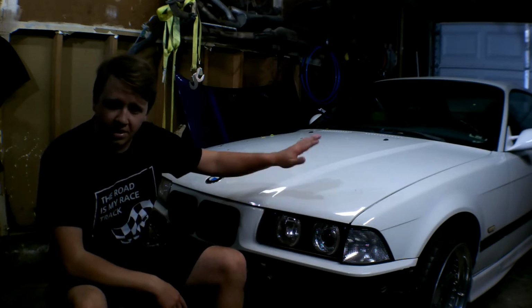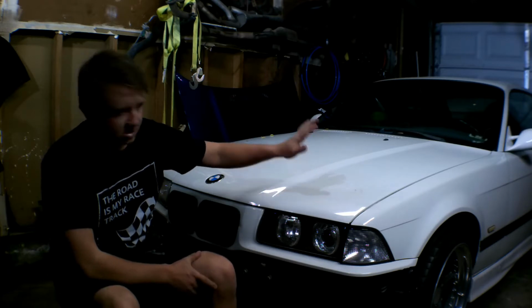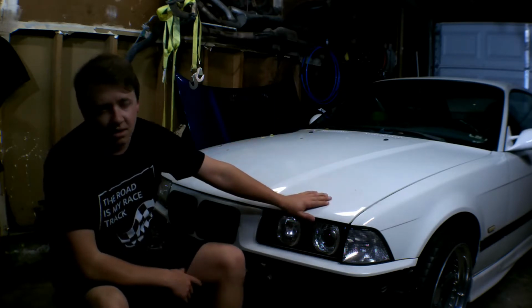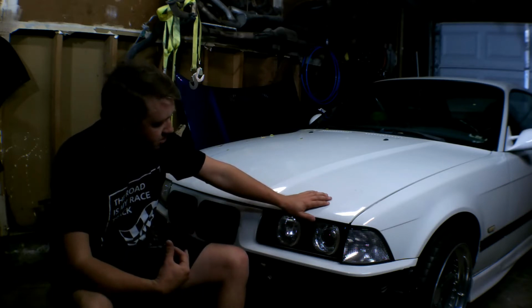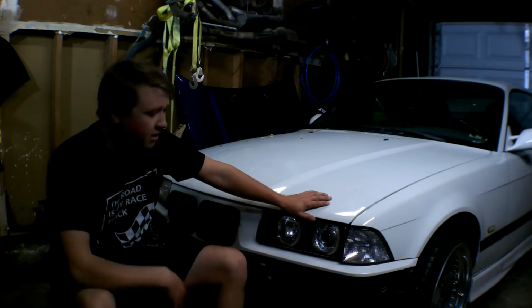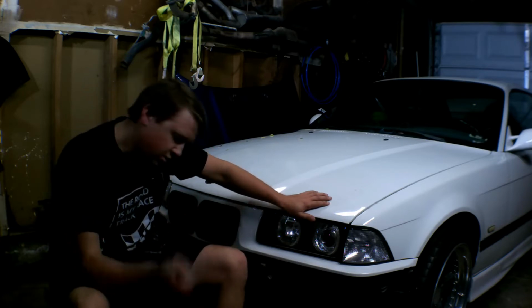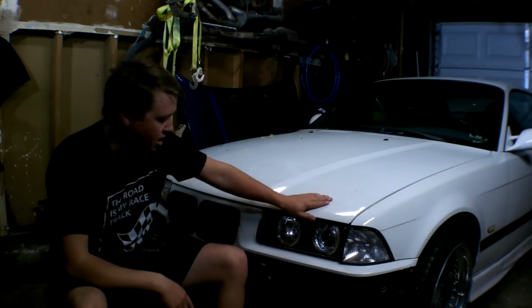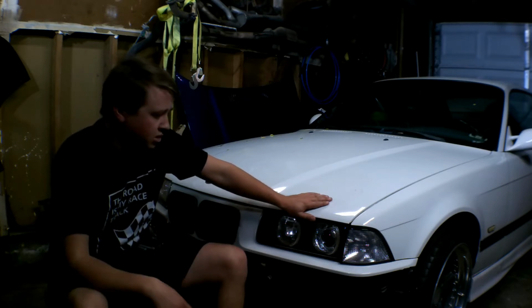We will be taking apart the intake manifold. What else is there? Injectors, fuel rail, intake, windshield wiper cowl. What else will we take out? We're going to loop that stupid throttle body heater back on itself and get rid of that crap. Pull all the ICV or CCV or whatever you want to call it.